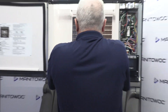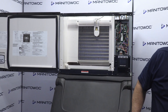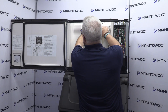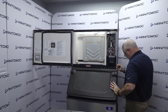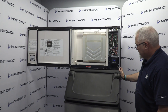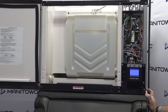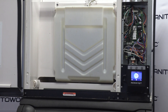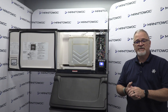Give it a push until you feel it snap in place. Reverse your other steps — put the water trough back in, reinstall your water curtain, reconnect power. It's going to check for an update. Turn the machine on. Fortunately, one of the first things that comes on is the water pump. I hear the water pump running — success! We're done. Hope you enjoy this video.